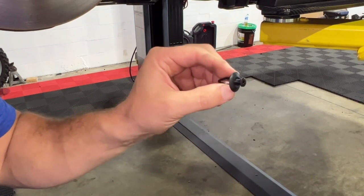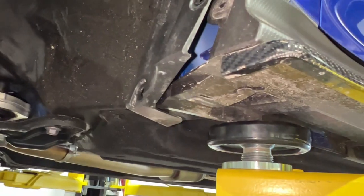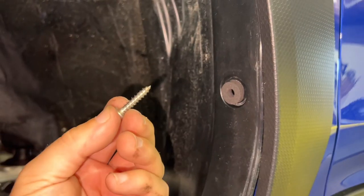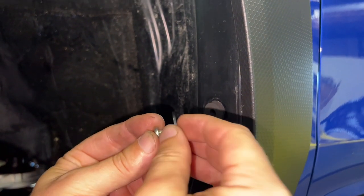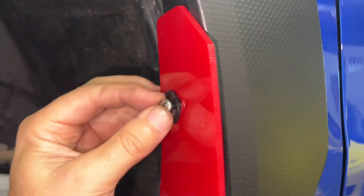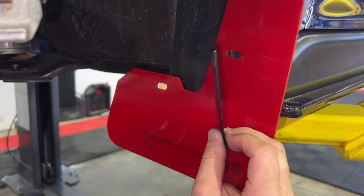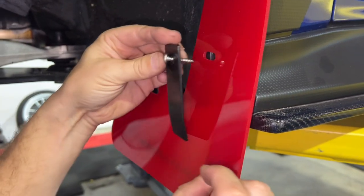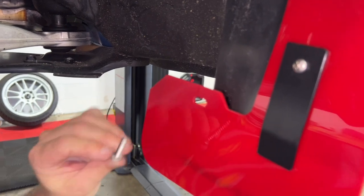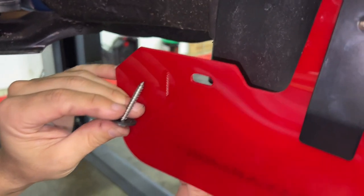Also provided in the kit is a plastic anchor and screw. Take the anchor and remove it from the screw. Take the new anchor and install it into this location in the fender well. Now install one of the plastic washers onto a short screw. Then with the front flap, put the screw through the hole and lightly tighten. Take the bracket with the angle facing the rear and install a short screw without a washer into the second hole. Apply a plastic washer onto the long screw, then install the plastic spacer behind the flap and insert the screw into the final mounting point.